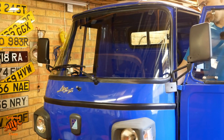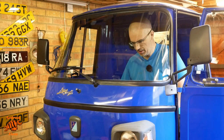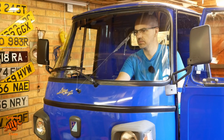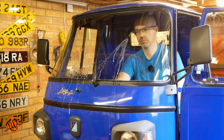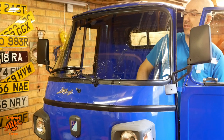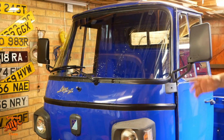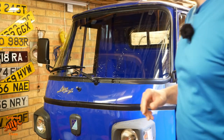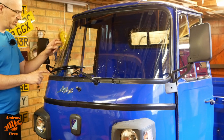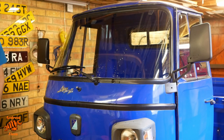Sticking with electrics: the horn — that's a strong horn, isn't it? Now let's have a look at the wipers. The wipers on these things are brilliant — they don't even park themselves, so you have to switch them off at the right place otherwise you end up driving with a wiper in the middle of the screen. The squirter works. The MOT legislation says something about whether the wiper is cleaning the screen effectively. The vast majority of the driver's view it's clearing, so I think that's fine. While you're looking at the windscreen, have a look for any chips or cracks.